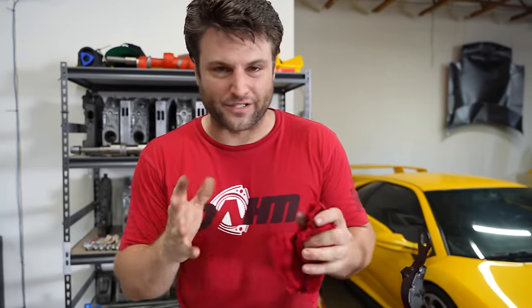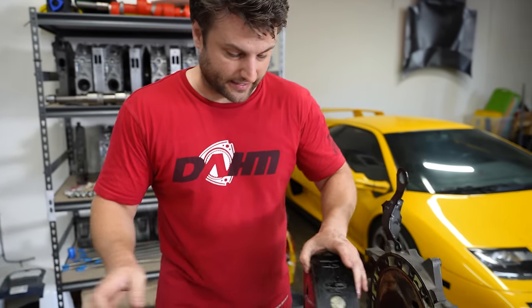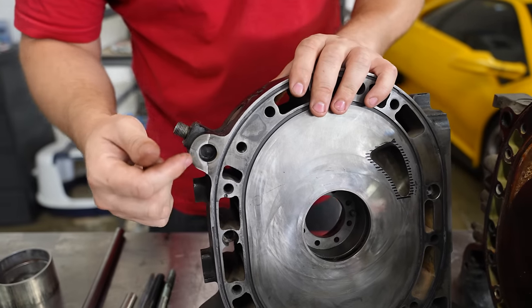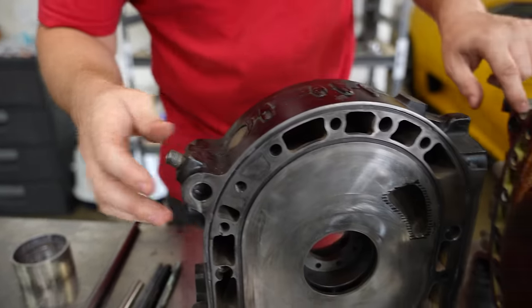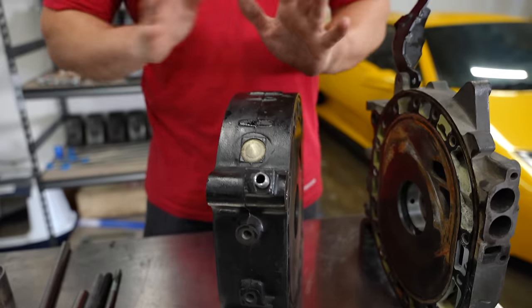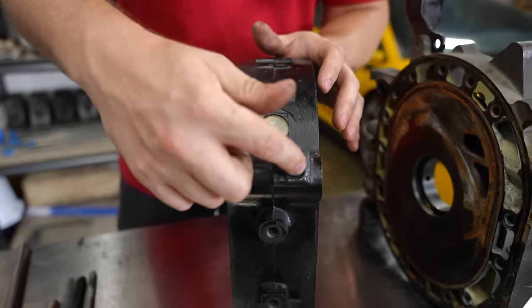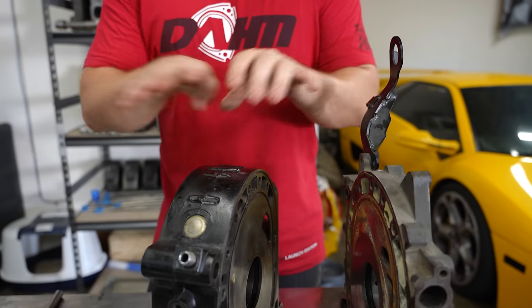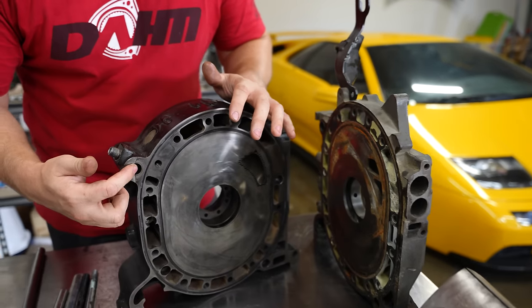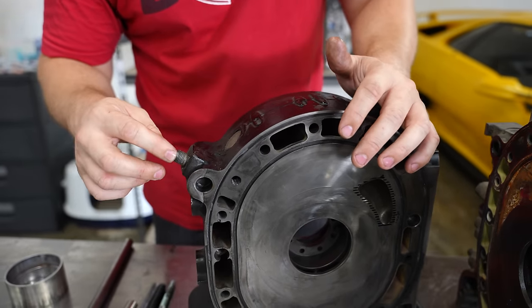The next major thing related to that same issue is preventing rotor wobble. Higher oil pressure would definitely help — the FD actually has pretty high oil pressure from the factory, but getting it up to 110-120 psi is pretty solid. Now the oil system: this plate with this modification makes the cracking not matter. I think this is a Decade 20B — supposed to be the strongest plate Mazda made for a three rotor. The solution is to say screw it, we know these will crack, so let's not allow oil to go through here. One of the best mods you can do hands down is the external oil mod, where you have oil coming in, split out to the front bearing, rear bearing, and turbo — so you avoid having oil going through the iron. If there's no oil through here, it can crack all it wants and the engine is fine.